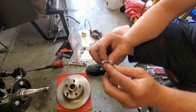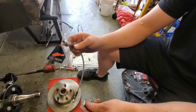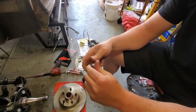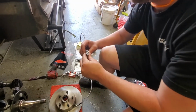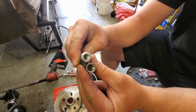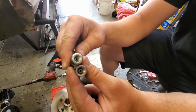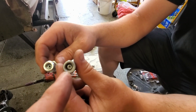This little clip actually comes with new clips. Now, just to give you guys two tips. Number one, the Wilwood kit comes with two different nozzles on it for two different ends of the lines. Okay, so there's a slight difference for our 67. I don't know what the other one is for, if it's for the 3-bolt spindle, whatever it is. For the 67 4-bolt spindle, we're going to use this one with this slightly thinner head,